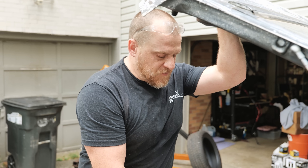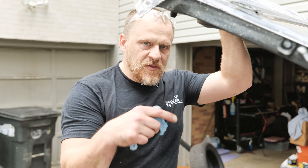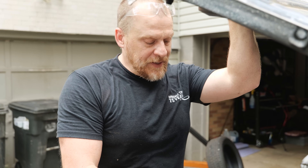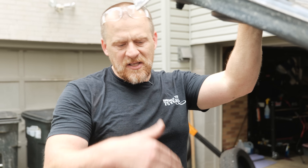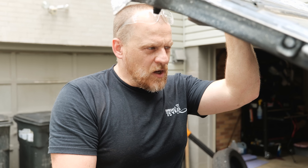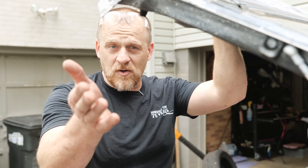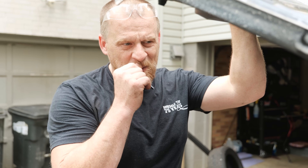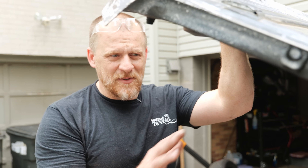One of the things Bo and I were worried about was the pump itself. We put some gas in it — the only other thing this could be would be the tank being low on fuel. We're showing a quarter tank and we put at least five gallons in, so we know we have fuel. I'm going to order a fuel pump, and then we'll get you guys after-pressure readings once we install it and continue troubleshooting this car to get it ready for Bo to start driving. I hope you guys learned something — we'll pick you up in a follow-up video with the new fuel pump installed. I'm also probably going to order a throttle position sensor because of the sticking idle contact switch, unless I can take it apart and clean it up. Stay with us — we will have a follow-up for you guys. Thanks for joining us.